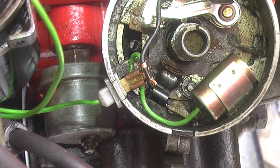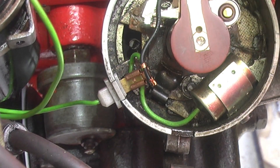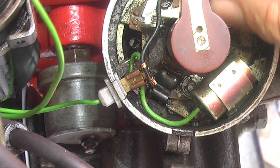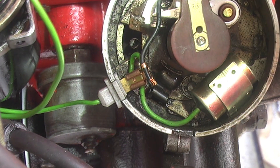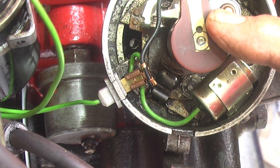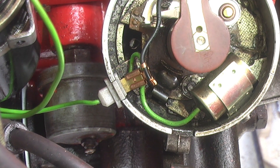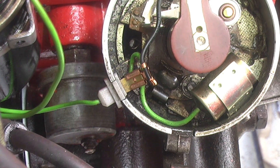There into view is the primary spring. What we're going to do is bend this tag out. If I put the rotor back on I can feel the centrifugal advance. Now that's rubbing up against the points there — the points are riding on the cam. So what we're going to do is bend that out a little bit. That should just about do it. You guys aren't going to have the experience I've got with centrifugal advance, so let's bend it out a little bit and see how you go — a bit of suck and see. So I've bent that out a little bit. It's going to start later, and I'm probably not going to get as many degrees mid-range as before because the spring's a little tighter.